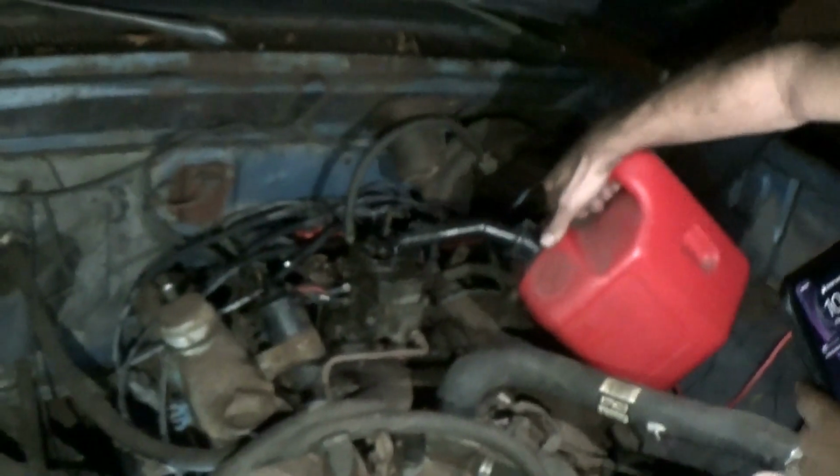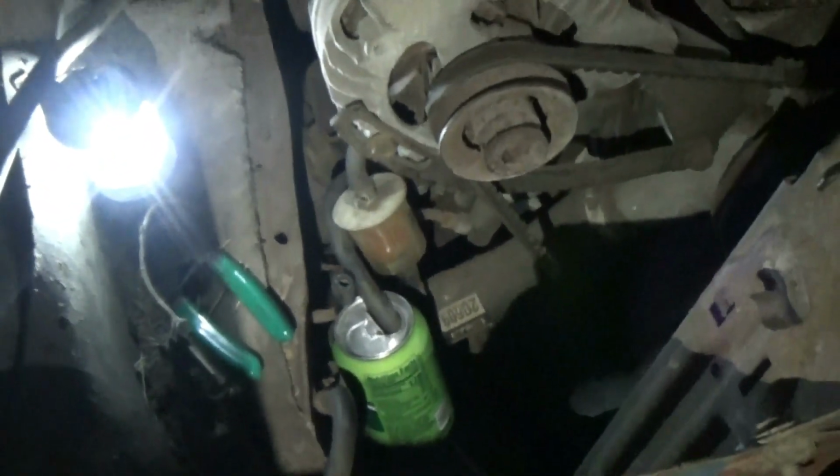That's if the diaphragm on the pump is still okay. Which would be a good way to find out. I guess this would fill the bowls in the carburetor up, and then we could stick it back on that line and get it to run for a bit and see if it sucks anything up. The line looked bone dry, so I'm not terribly optimistic. Probably the sock is plugged.